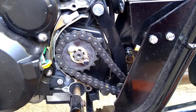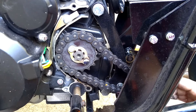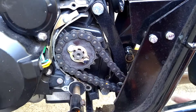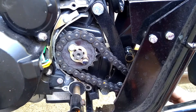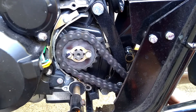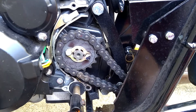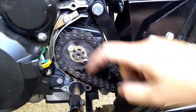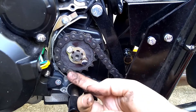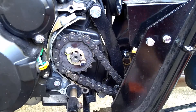If you're going to lengthen or shorten a chain, you've got to find what's called a master link. You can see all of these standard links here — these are holding it together. There's a master link that allows you to take it apart easily. So if we just rotate it around — I've got it in neutral so I can turn it — we can see right there is the master link. You can see it's got kind of a C-shaped clip here. I can push it off, then the front plate is going to come off and the chain is going to push out to the back.